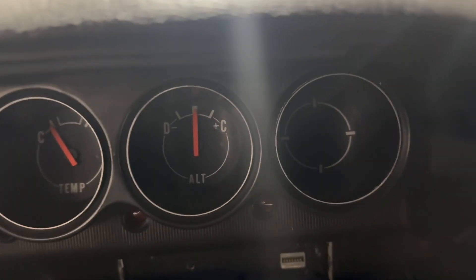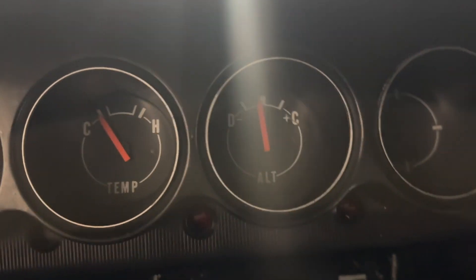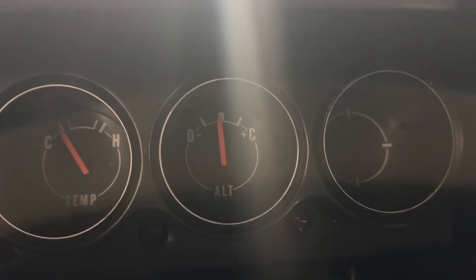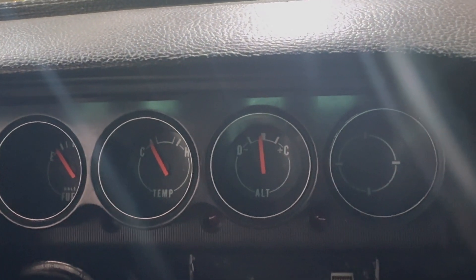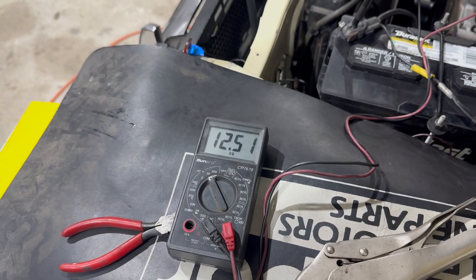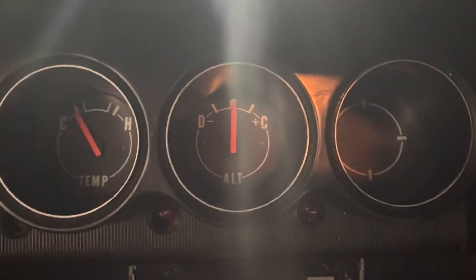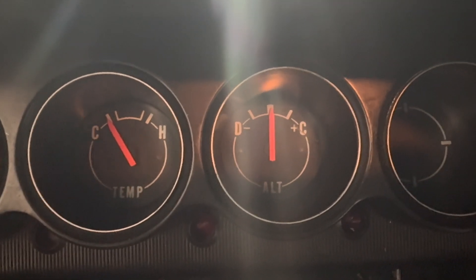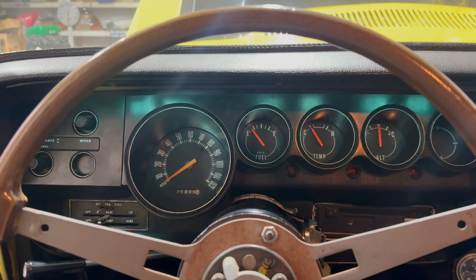I'm in the car now, and I want to check the ammeter action with that wire in place. First, with the headlights turned on it does still show a discharge. The question is if it'll actually show a charge once it's running. It's not indicating any charge at all — what that tells me is all of the charge is going through our new circuit and not the factory one. Because we've shoved the charge output off through that other wire, we're only seeing the loads, so it's indicating a discharge even though the battery is in fact being charged. Apparently I had knocked one of the brush connections off of the alternator. It's still indicating a charge now, but there's not as much gauge movement as there would have been originally — and that's good, because it's telling us the load has been taken off of the factory circuit.